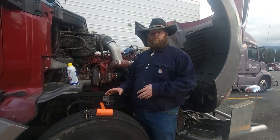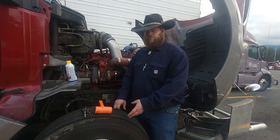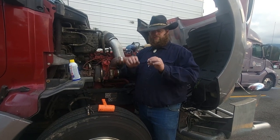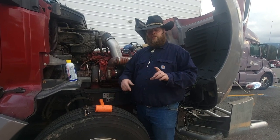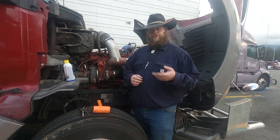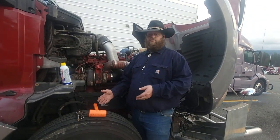The system also works with your traction control system, so if one of these components fails, you lose your traction control as well. The magnetic sensor — the wheel speed sensor — picks up a tone ring. The tone ring looks like a castle when you're looking at it flat on, and it's fixed to the metal on the inside of your rim or hub. For the computer geeks out there, it operates in binary — zeros and ones — so it reads on/off signals and that's how it picks up how fast your wheel is moving.